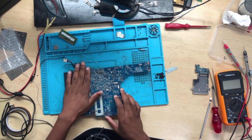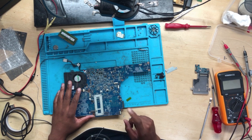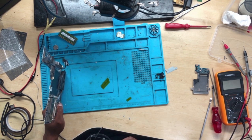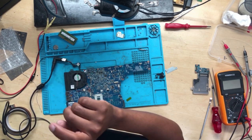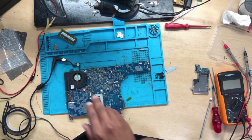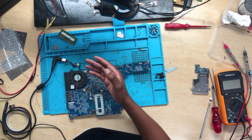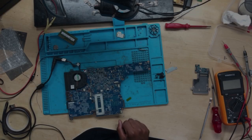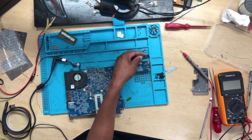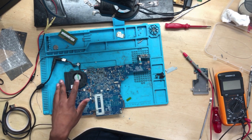I have the board right in front of me. Right now there's no power button, but I know some laptops turn on without a power button. Let's try. Remember, it was turning on and then shutting down. Now let's see — it's turning on, fan is spinning, and went off. Okay, we need a power button. It keeps turning on and then quickly goes off.